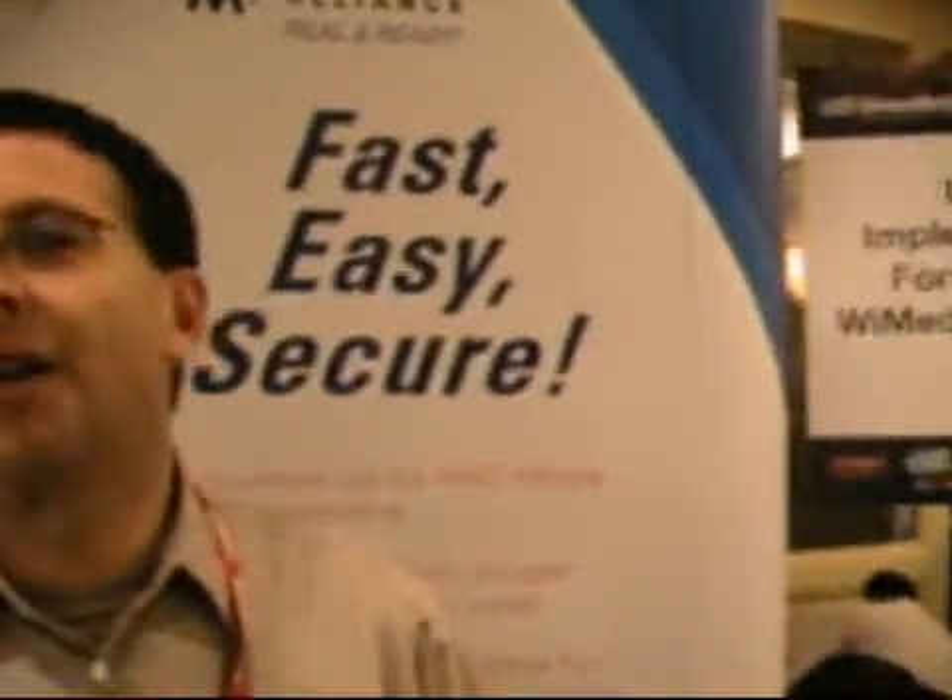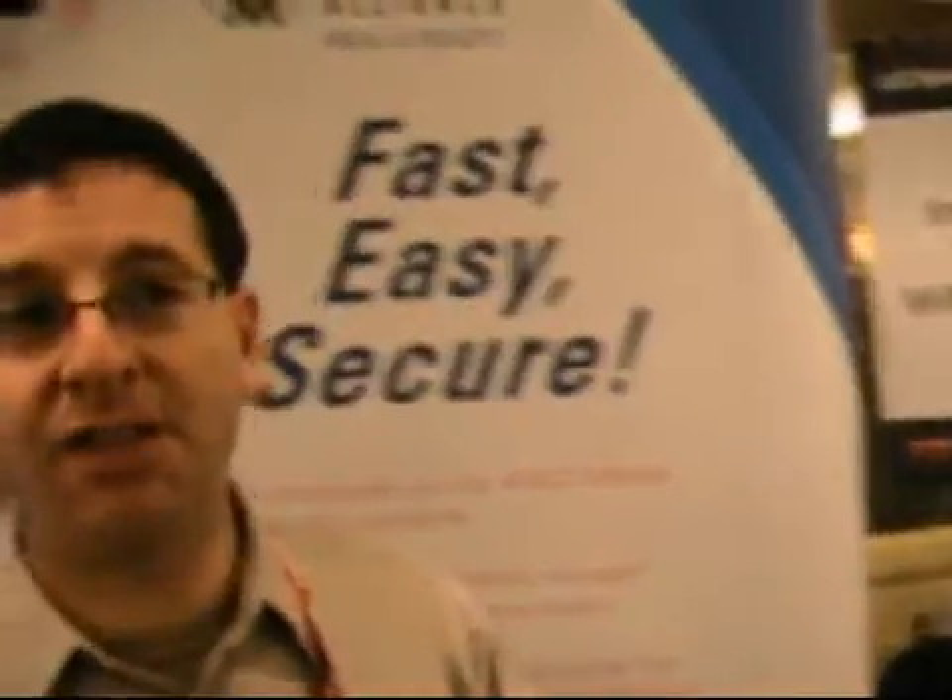Practically speaking, people usually connect up 8, 9, or 10 different devices — but that's still twice as many as the USB ports on a typical notebook. A wireless USB notebook will be able to connect up to 127 different devices. You're going to start seeing notebooks with this as an available option around mid-year. They'll have it in a mini card form factor so you can order it with or without the wireless USB mini card.